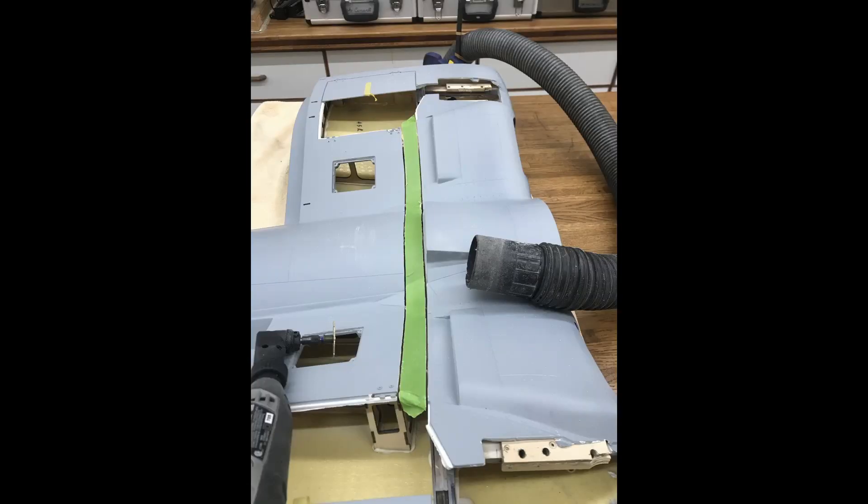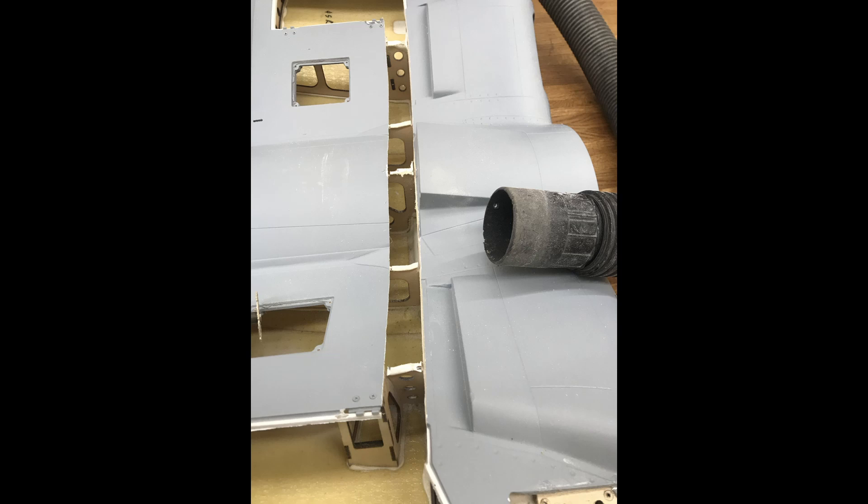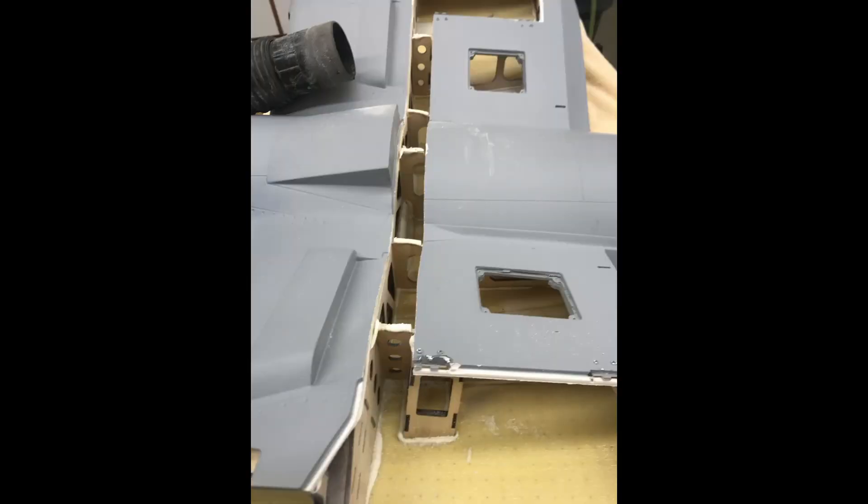Just use the vacuum sweeper. I've already got it cut out. We're going to wiggle it back and forth, and you'll see that the lightweight epoxy they used kind of fatigues out pretty quick. So we need to pop this off all in one strip — just be patient and wiggle. It will come out, and you can see it right there. If that wing starts moving at all, that epoxy is going to start letting loose.